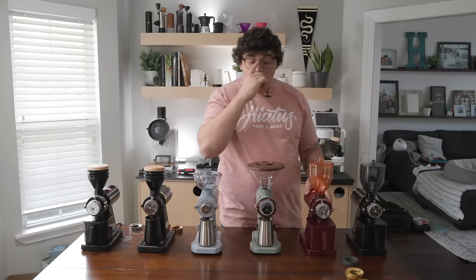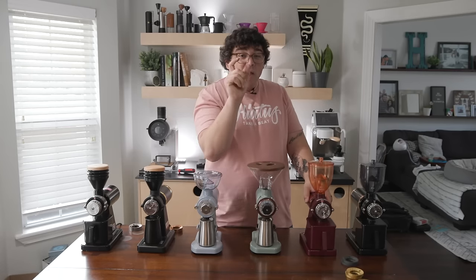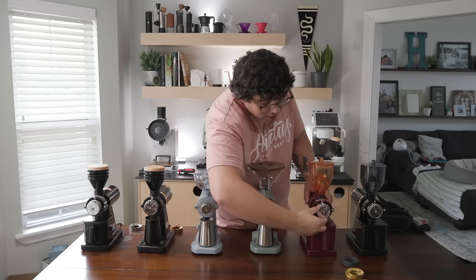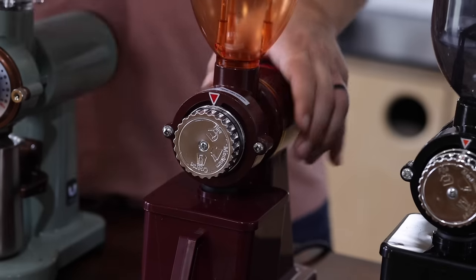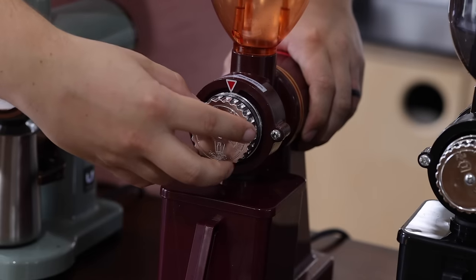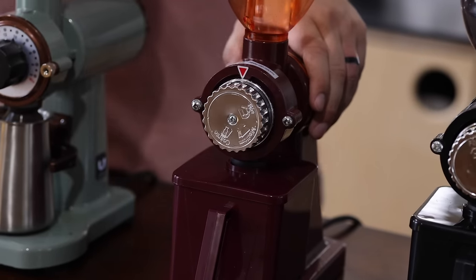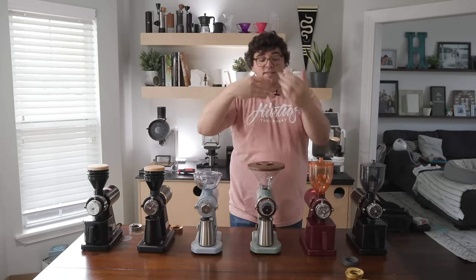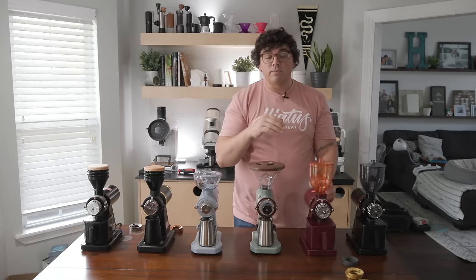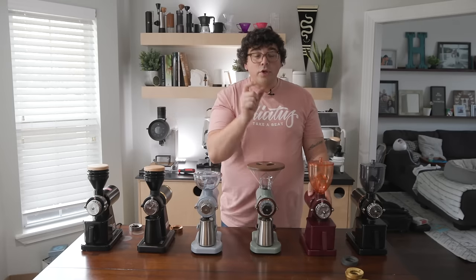So the issue is, when you replace them, you are caught within just a small area that you can grind, and it's only espresso grounds. When I was doing it, I couldn't get coarser than 3 before the burr started to rattle, and the reason is because it lost pressure. I got so coarse on the knob, once I calibrated it to zero touch, I went out, and I was so far out that the nub came inside of the housing of the burr, whatever that term is. I'm blanking. Anyway, you really only have 1 to 3.